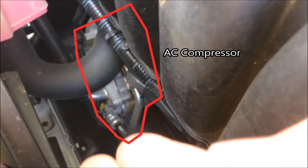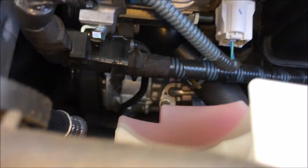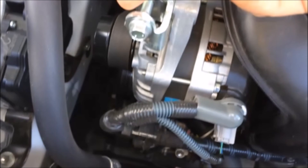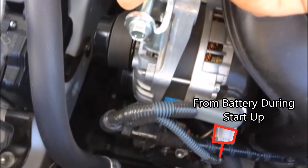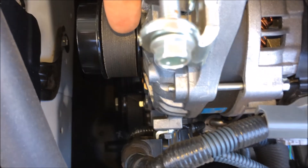We're going to come over here and look at the AC compressor. Also in this picture you have the lower radiator hose going into the water pump, which was kind of hidden in this video. You can see the compressor a little better here, along with some of the coolant reservoir fluid, and the serpentine belt attached to the compressor. Here you get a close-up of the alternator, and you also have this tube — again, this is the low pressure AC line. The alternator has two electrical clips connected to it: the little clip down there is from the battery during startup, which gives it power to start up and then turns the serpentine belt. The little clip on top is for the dash light, and as the motor is running, it draws its power supply from that one.